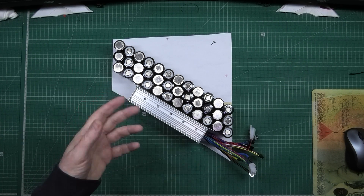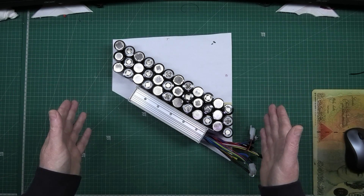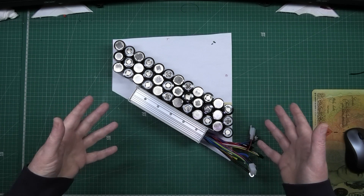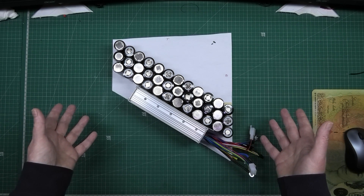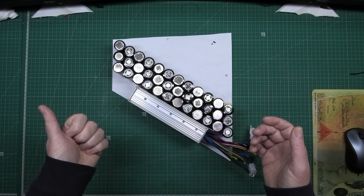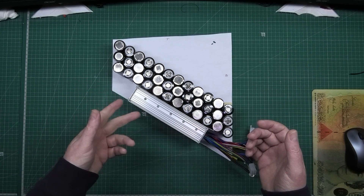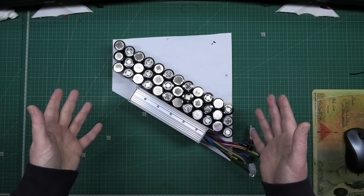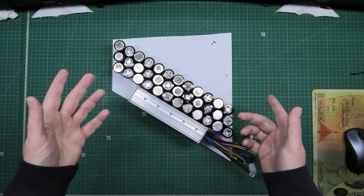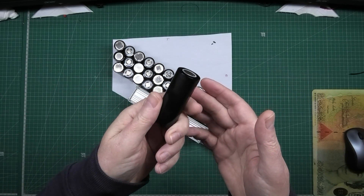If you have a 1500-watt motor doing that speed and distance, you'll need a one-and-a-half kilowatt-hour battery. For people who've emailed saying they bought some massive-sounding battery from China and it only gets them five miles — I'm not surprised. You've got to do your homework. You need to know what cells are actually in the pack, what amperage they'll take, how many in parallel, how many in series, and what the voltage is. You can't just buy something cheap because cheap batteries are always made with rubbish cells.